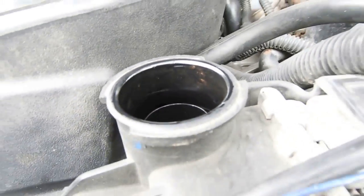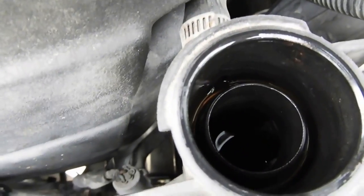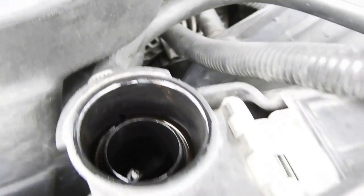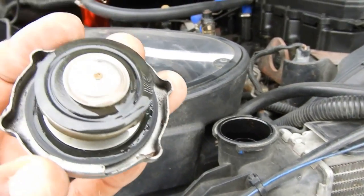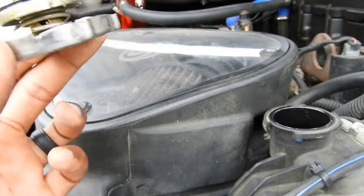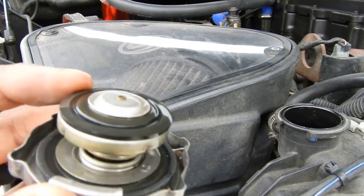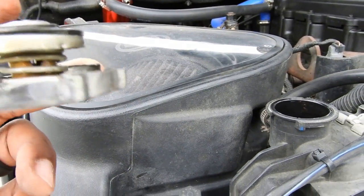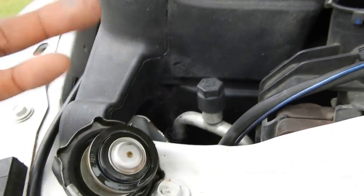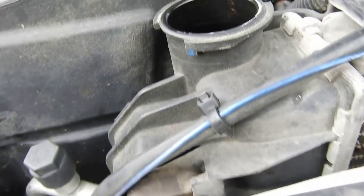When I went to the hardware store, I made sure I came back real quick. One way you can look to see if you've got nasty coolant — look at your radiator cap. If the bottom of it is caked with orange and grit and stuff, or Lord forbid oil — if you've got oil in your coolant, you know you've got big problems. But just check it out, look in there.